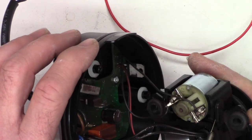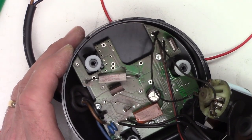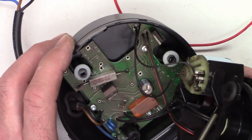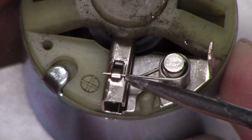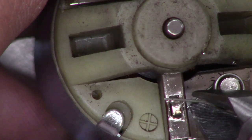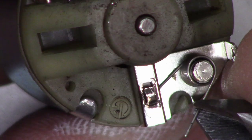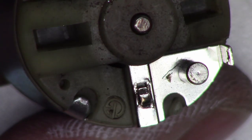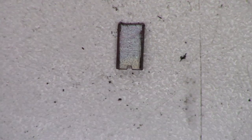There's the bottom of the motor — you can see the brushes right there. There's the relay and some other associated components. Let's go ahead and look at the motor itself to see if we can find a bad comm bar on the commutator. We just need to release these springs and take the spring completely off, pop that spring out, and see if the brushes will come out.